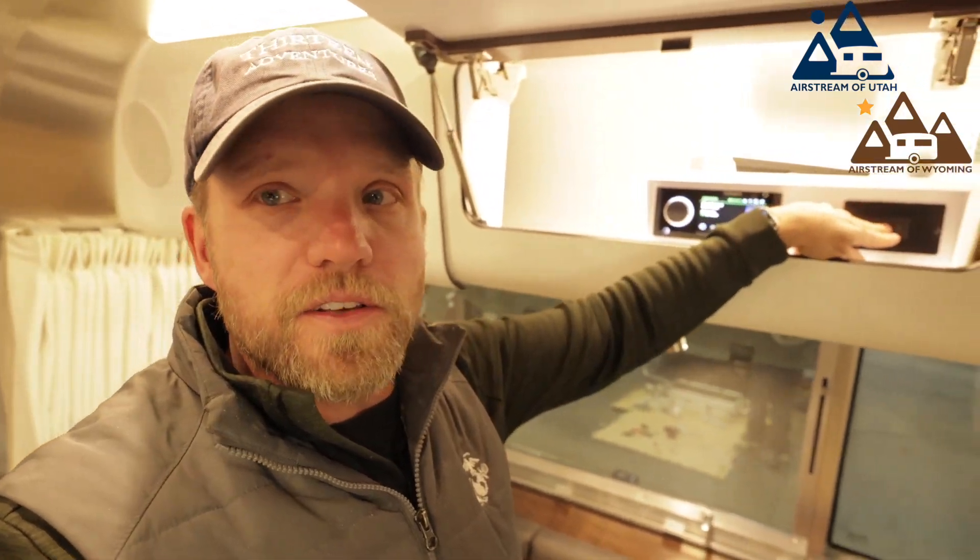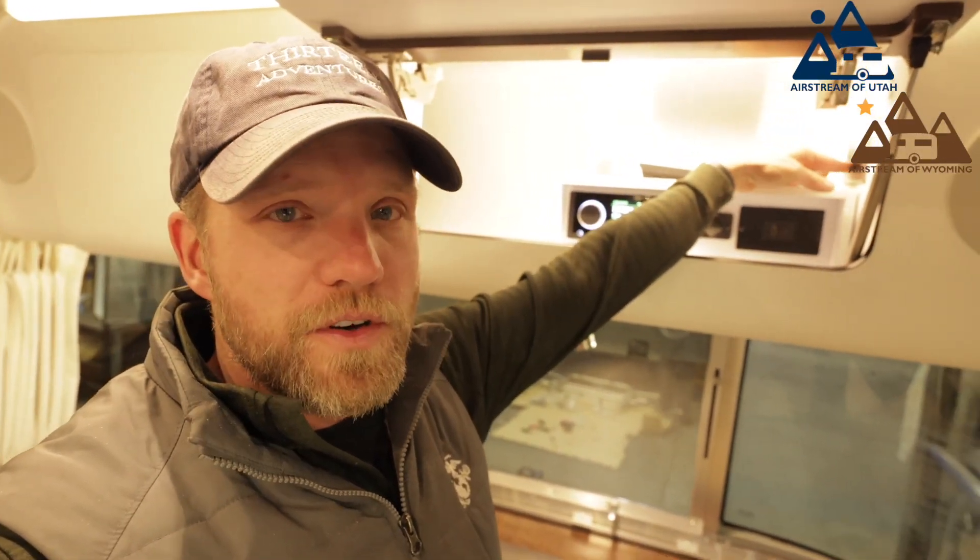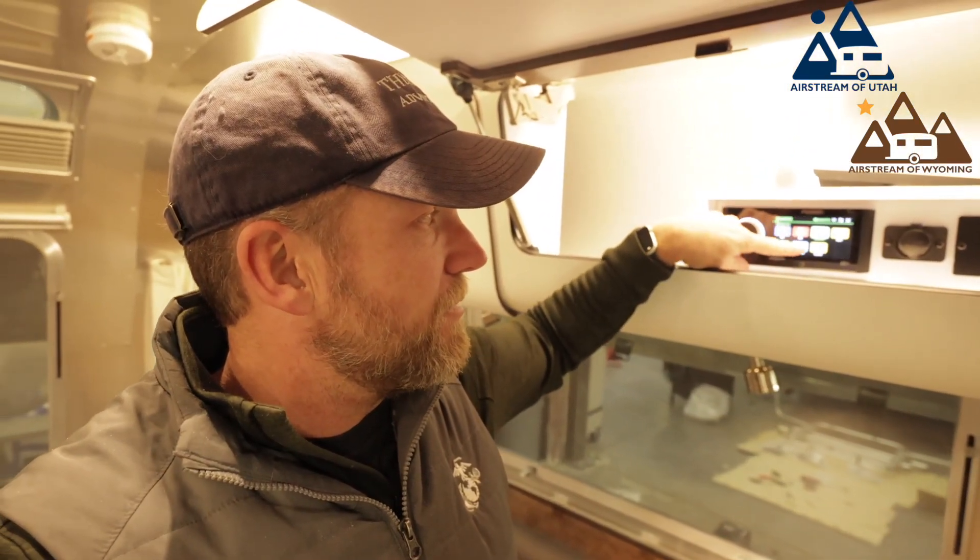Many people get a streaming device, like an Apple TV or Roku stick, and they plug it into this USB port, power it up at the inverter outlet, and then run the stereo system via the Bluetooth function on that. Because although it says TV here, the TV does not connect to these stereo systems in Airstreams — that's a wiring issue — but you can always connect with Bluetooth, and that's a really handy feature.